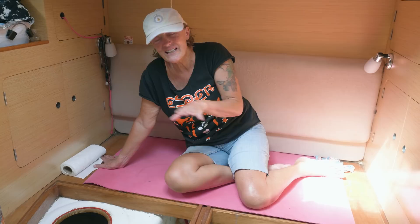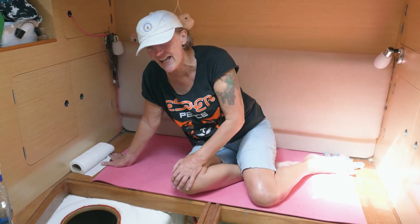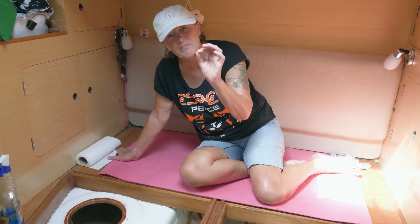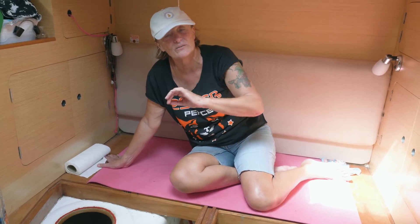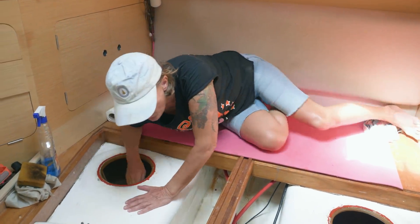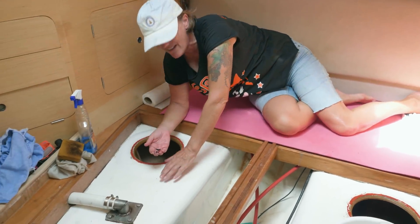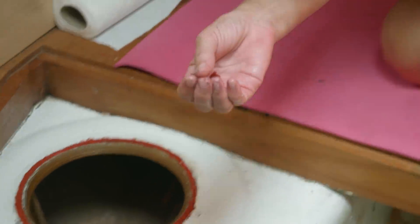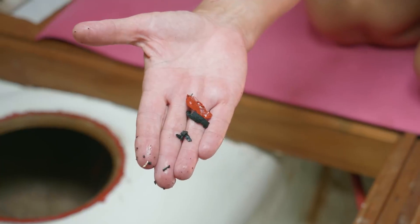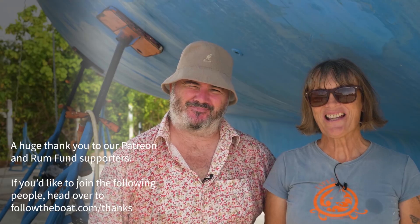We last saw Ricky and Jamie putting everything back together — tanks leak cured, which is good. But when I pulled out the last of the diesel I got a shock: there are all kinds of bits of black rubber inside, which can only have come from the gasket that Jamie and I put on. It's all crumbling and coming out into the fuel pipe and tank. So we've got to take everything out, clean up the pipes and tanks, and do a new gasket.